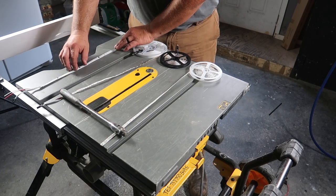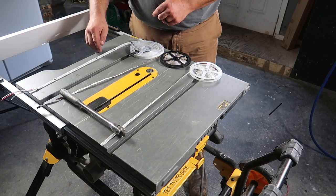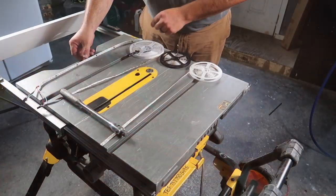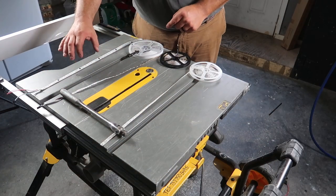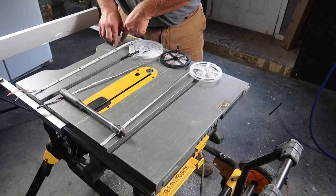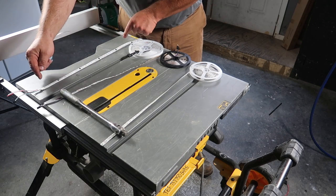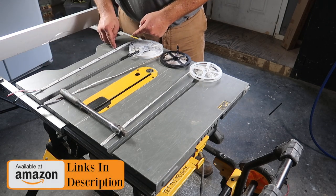This is your dream color strip, and this is what we're making today's video on. This strip has a weatherproof silicone coating and a three-pin connector. It has arrows on the strip, meaning the LEDs can only be fed in series in one direction. The reason is because individual LEDs on this strip can be different colors at the same time — a fade can start at one point and fade from one color into another on the same roll, unlike RGB where the whole strip fades as one.